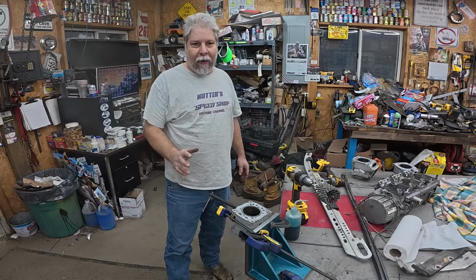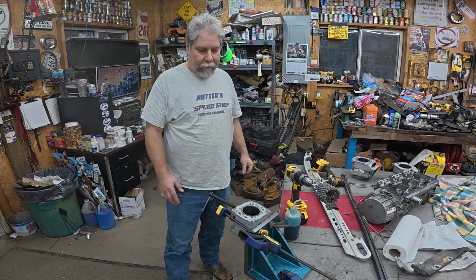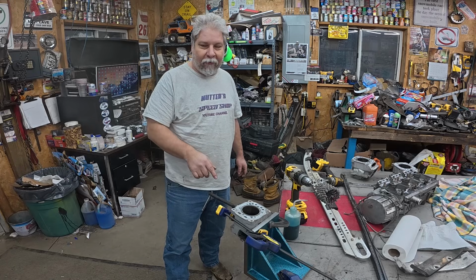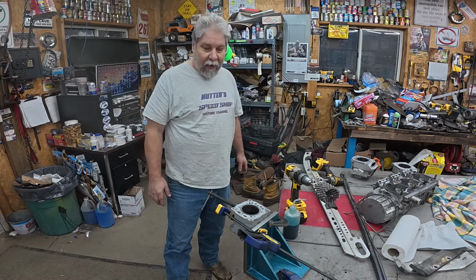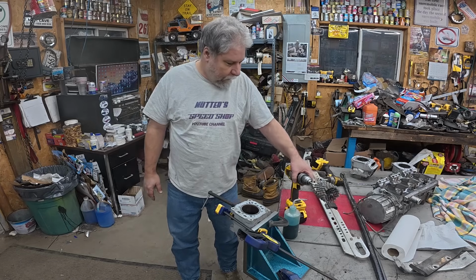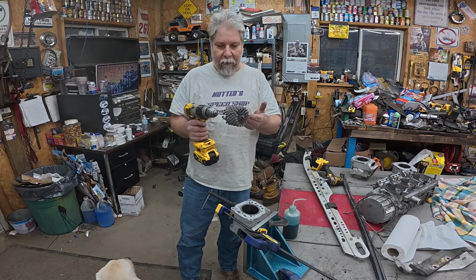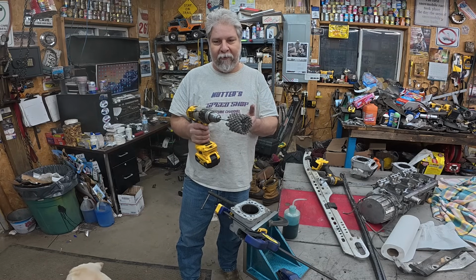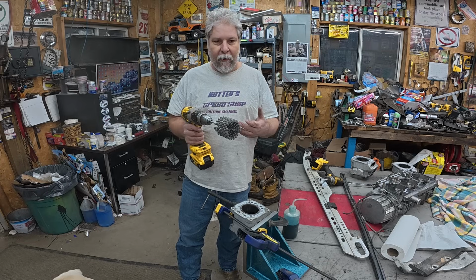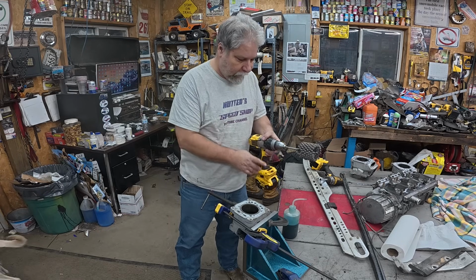So the Nikasil in Hot Donna's cylinders looks pretty good. Well, there's no aluminum showing through. There's some stampings on some of the cylinders as if they've already been re-Nikasiled once. Definitely needs a ball hone though. So I bought a ball hone. If you want to know exactly what it is, it's a 240 grit aluminum oxide ball hone, and the size is 2 7/8. I had a different ball hone for Brad's Ultra. It's too small for these cylinders.